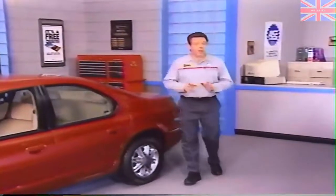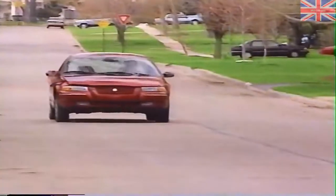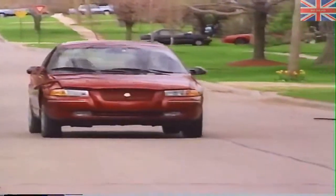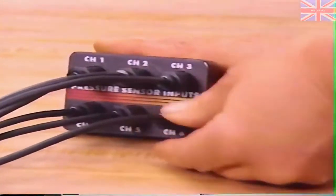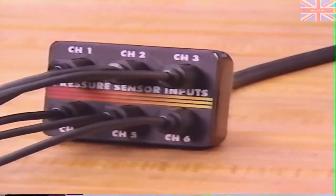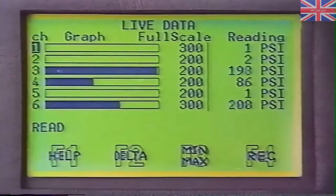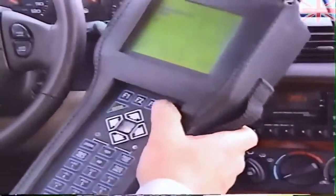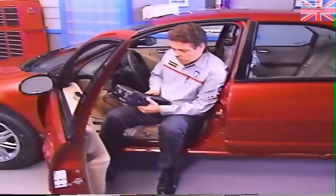The multifunction PEP module brings with it the ability to view digital pressure data on the DRB-3. This eliminates the need for long pressure hoses and mechanical gauges during on-road pressure and vacuum testing. With the digital pressure tester and optional accessories, you can analyze pressure data from up to six different test points at once. All pressure data is displayed on the DRB-3 simultaneously, which facilitates signal analysis and comparison. This data can also be recorded during on-road pressure testing and played back at a later time.